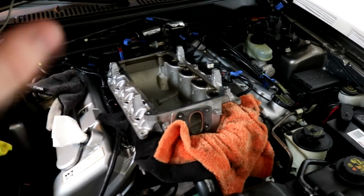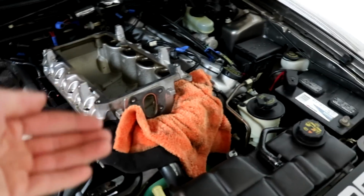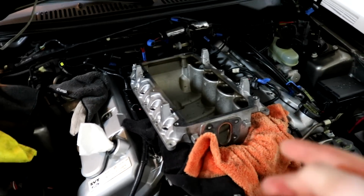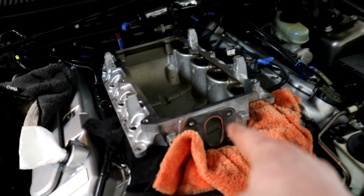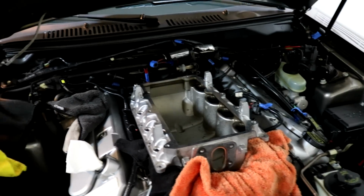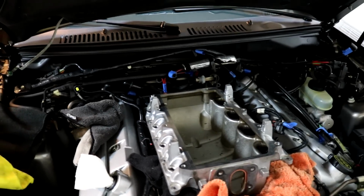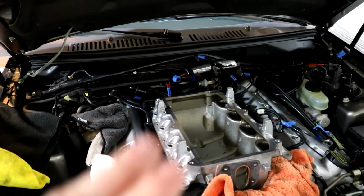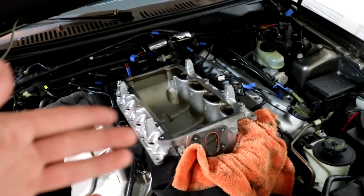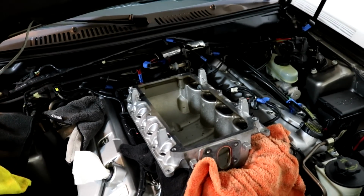I have all winter and I knew I would have tons of time, but I've been just itching to get this done. I don't know what it is, but I'm gonna get right into it. Super easy. So I'm just going to explain the steps. Right now I have the intake manifold propped up on the coolant pipe. So what I'm gonna do is I'm gonna drop in the supercharger, bolt it down, put in the coolant block, I guess you would say, and then I can therefore drop it back down to bolt the intake manifold up. I think the intake manifold's like 12 foot-pounds or 15 foot-pounds, I'm not sure. I'm actually gonna torque these, unlike the intercooler to the supercharger. And then after that's bolted down, you just have all this wiring, vacuum lines, and it's just a straightforward shot.